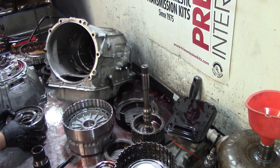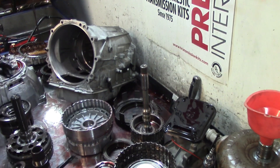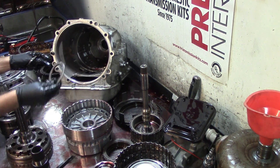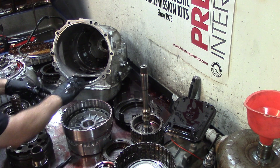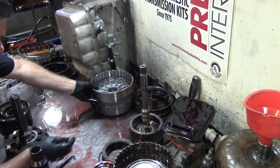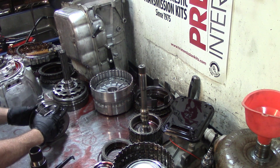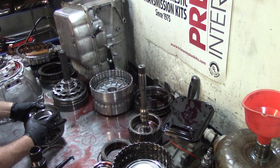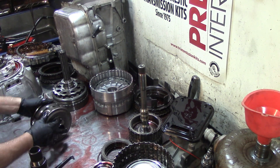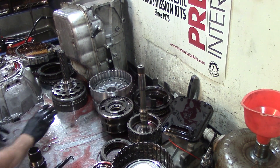Let's get this planet out of here — I just used the seal puller to pull it out. Planet ring gear with the output shaft, and this washer in the back. Stand our case up to finish draining. Check all the teeth on your planet — it's very rare but they do get damaged — and check the thrust washers as they sometimes wear out.